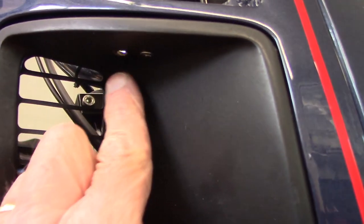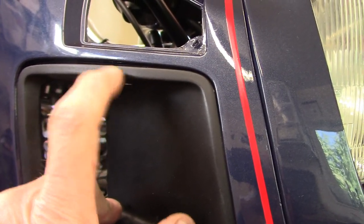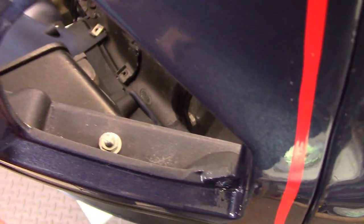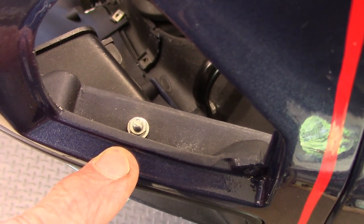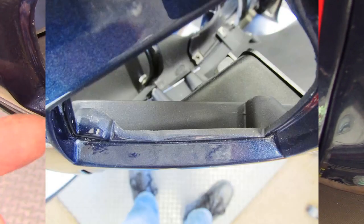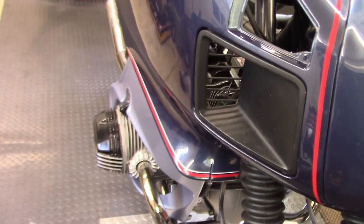The side vents mount with a screw that goes in here, and there's a neoprene washer that fits between the vent and the fairing. On top there's a flat washer and — in theory a lock nut, which I don't have — so I used a wave washer and a standard nut to secure it. This rib was not drilled for the vent, so I had to drill a new hole through the rib and through the vent to mount it.